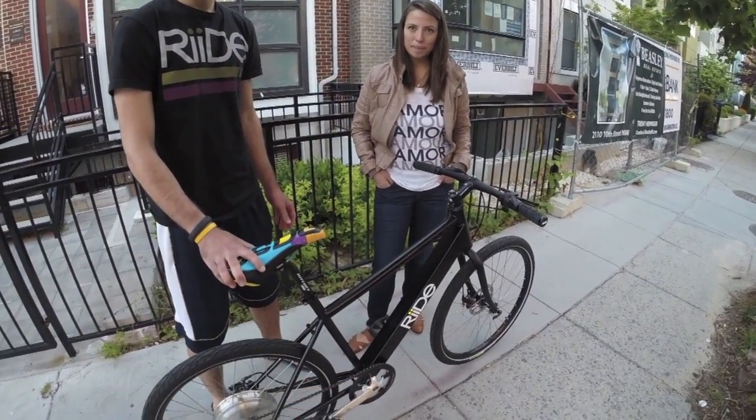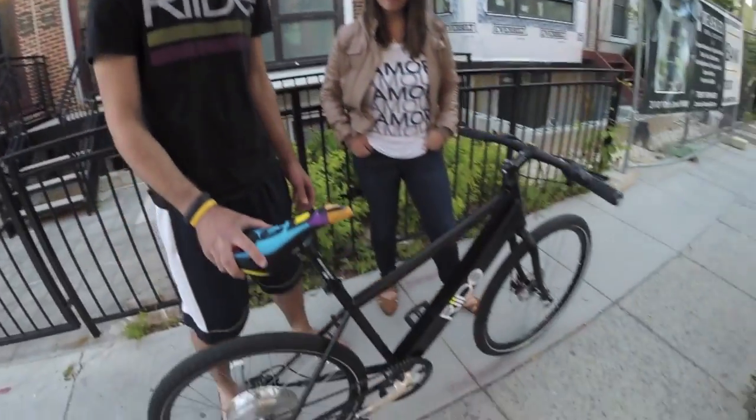This is a Kickstarter bike — crowdfunded with a lot of people getting excited about it. On your original models you were modeling in steel, and some of the properties of that allowed you to drill into it and really dial it in before going to aluminum. The benefit of steel is that you can really change things on the frame after it's been built. With aluminum, once it's heat treated you're kind of stuck with it, so it made it easier to prototype and try different things.